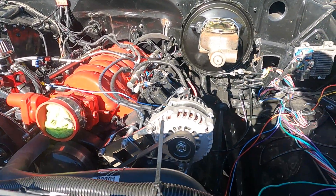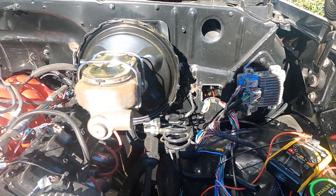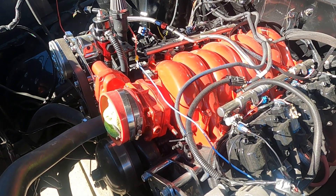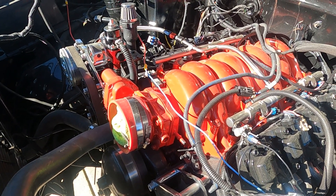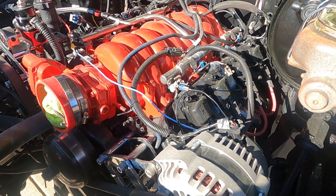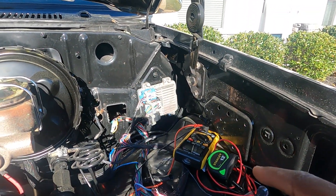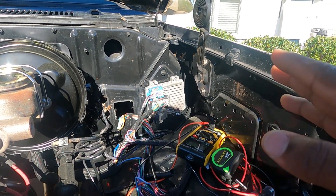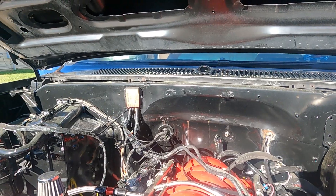So here I am, I'm trying to get the PCM wired up. I got the E40 ECM, I got a LY6 Gen 4 LS motor — more comparable to the LS3 excluding the intake and the heads. As you can see, that's an LS3 intake on here. Pretty sure these are still the factory LY6 heads. Got the E40 ECM which is the hybrid ECM, and we got the connections for the transmission and the ECM all right here — it's not two separate ECMs.